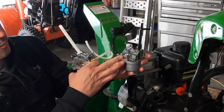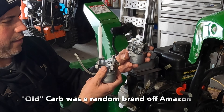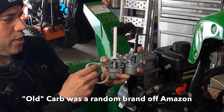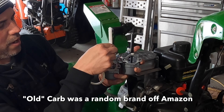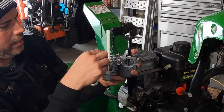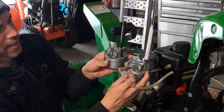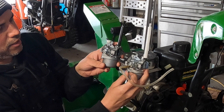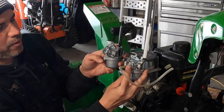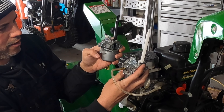Here's the new carburetor from HIPAA, and here is the old carburetor I took off. They have different rods for the choke, so we need to take the white one off of the previous carburetor, take off the black one from the new one, and install the white one onto the new carburetor. The other difference is that the new one from HIPAA does not have a port for a primer, so this hose that used to go to the primer bulb just won't be installed any longer.